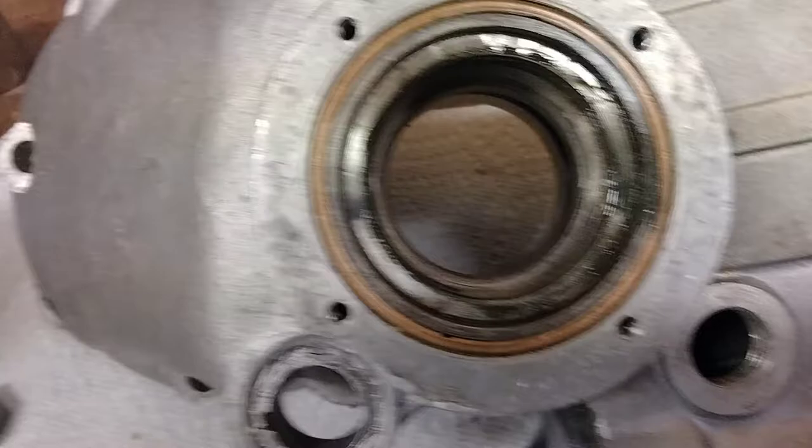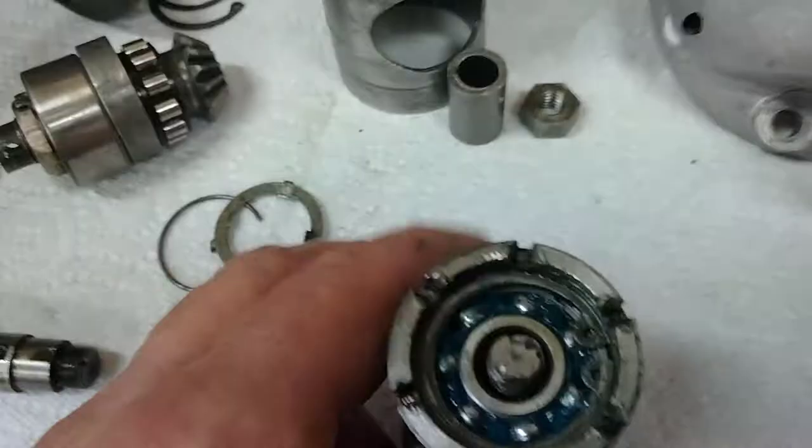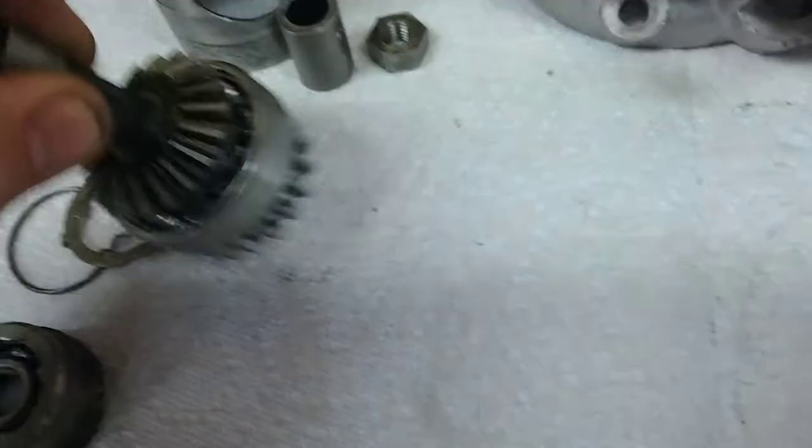Once you get behind that, you will find a retaining clip and the spring. The retaining clip goes into here, goes around the hooks and ends up in this hole. So you take this off, take this out, and then you can extract this bearing. You can also take off that nut and gently tap out this bearing — obviously with some heat.